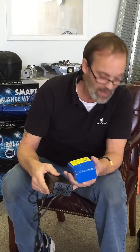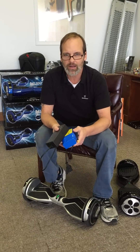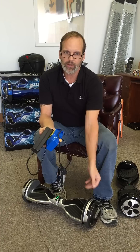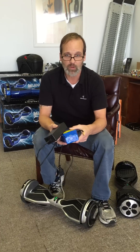Number two: never get your machine wet. These units don't have a seal between the hub motor and the inside casing. So if you're out there riding, even if it's not raining but the pavement is wet, conceivably you could get water inside the casing and it could get into the battery. Lithium-ion and water do not mix — I've seen them burn.